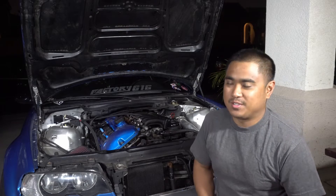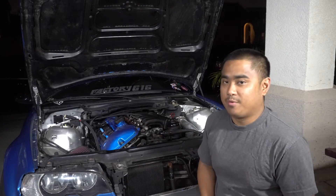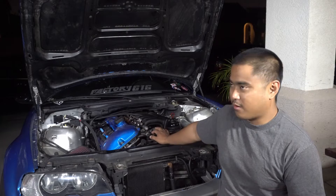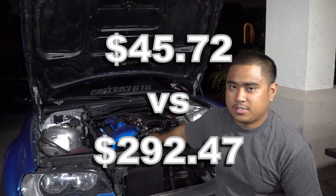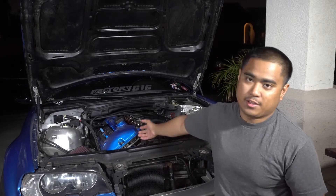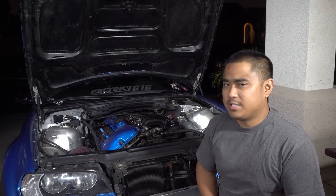For maintenance and refresh, we're going to assume you go full send and do no maintenance, addressing things as necessary. Obviously you're taking a risk by skipping preventative maintenance, but that's your call. Let's assume you got a unicorn 330 where the previous owner did all the maintenance. The only things I'd really do are spark plugs and an E36 manifold gasket. You could argue spark plugs aren't necessary, but for a couple bucks and how easy they are to access, you might as well do it. Same with the E36 manifold gaskets — they'll be better than the OEM unit and give you less headache down the line.